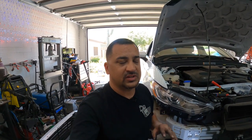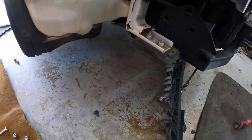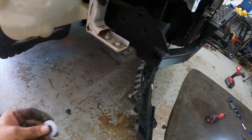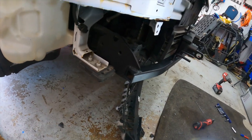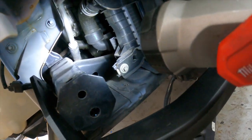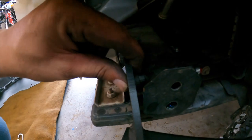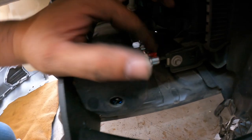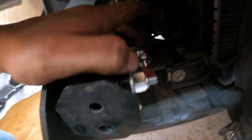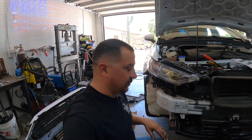Once you get the holes drilled, you're almost done except for reassembly. The instructions say take two of your longer bolts and feed them through with your quarter-inch spacers. Big washer on the back, Loctite, and the nut. You also need to put this piece in — it faces down and slides in there, going through that hole. You've got your two spacers on this side, your washer, red Loctite, and nylock nuts. The four-inch half-inch bolts are here, three-and-a-half-inch ones in the back. This bolt, this one, and that back one are all torqued to 78 foot-pounds. I ended up calling Blue Ox just to verify — glad I did because I was looking at the wrong numbers.